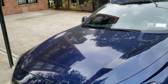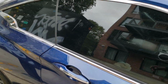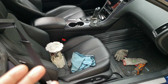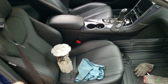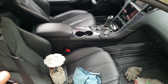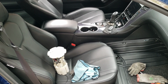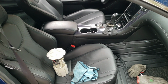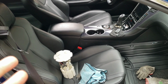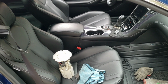All right, so let's jump into it, guys. Other YouTube videos are going to talk about the replacement of the low pressure fuel pump, right? Because the stock fuel pump can't run up to E30 mix. I've heard that you can actually run up to E50 mix depending on the low pressure fuel pump you go with, but it's recommended, if you want to run E30 mix, which is about 30% ethanol in the gas tank, or E85, you will have to upgrade your low pressure fuel pump because you will possibly have fuel pump issues depending on how your car is tuned.